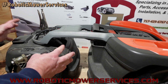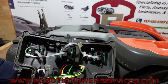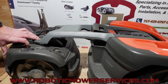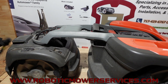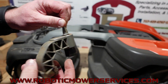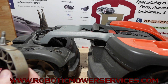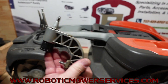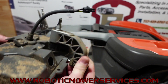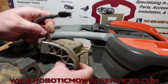If you watched the video where I tore the rear chassis apart from an all-wheel drive and showed you what was in there, you remember we talked about this center magnetic sensor board right here. The two on the outside are for the magnets out here to tell if there's a collision or any kind of movement on the body — front, back, side to side. But that middle one is to sense the placement of this magnet right here, which is in the bottom of this shaft, which is in this arm. That arm is right down there, that shaft is sticking up through, and that's what my vice grips are clamped to. This arm is mounted to the rear chassis, and when the rear chassis moves, the shaft is held in place so that the magnetic sensor board is actually moving underneath the magnet.